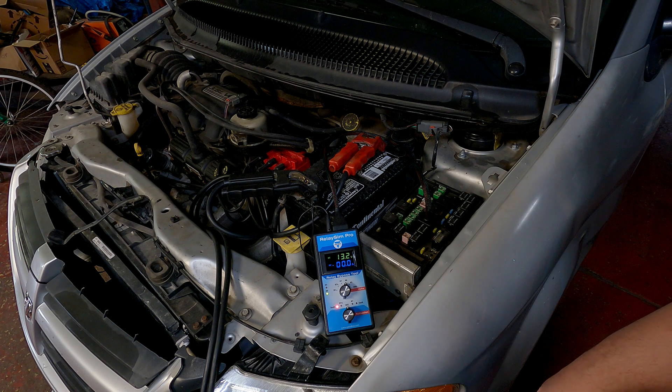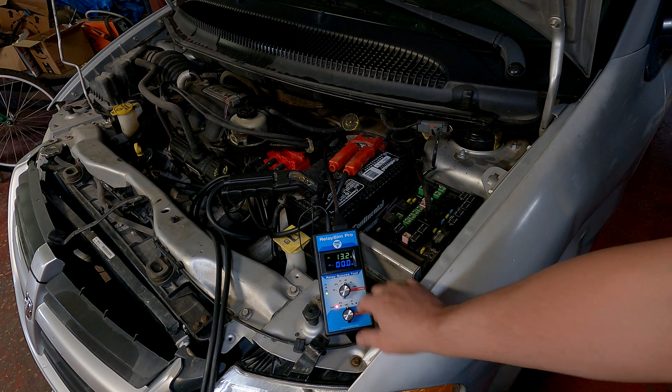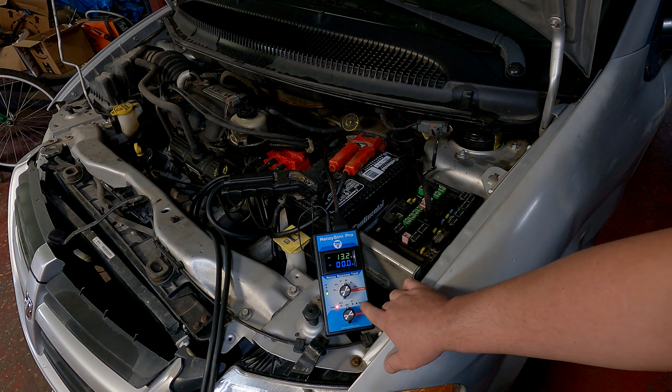This tool can help you extremely quickly identify any faults at a relay. I did a little messing around with it yesterday and easily saved 15 to 20 minutes of time. In 5 minutes I knew I was chasing an open on the output side of a relay. This tool is extremely valuable. It's definitely going to be in my regular daily go-to when testing relay circuits. My only complaints are I would like to see — when the fault light's on — maybe an option to switch on a speaker or a buzzer, so when I'm chasing a circuit fault and wiggling a harness, I could hear that beep or buzz.